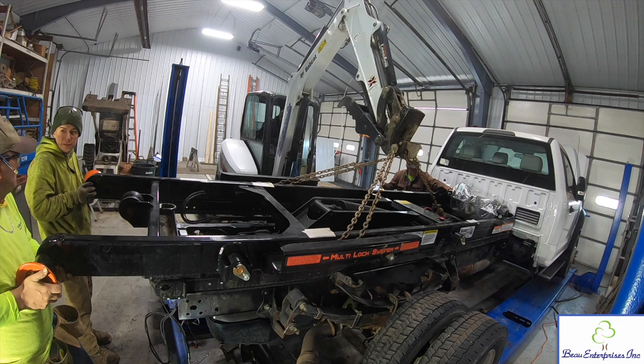I just want to point this out real quick. My truck frame was actually too short by about a half an inch or so. I ended up adding back a half an inch right on the end of the frame. I don't know if it came from the factory like that or if it was cut off when they put the original bumper on, but it really screwed with my placement of my rear hinge bolts. I ended up moving the hoist forward about half an inch initially, then added that half inch back to give me some bolting area — but I should have just added extra and drilled my holes after.